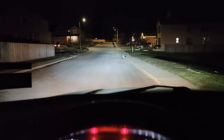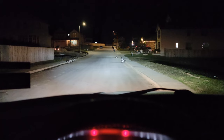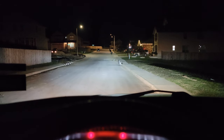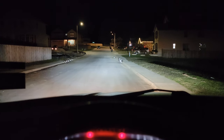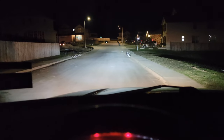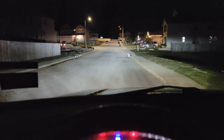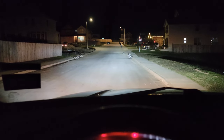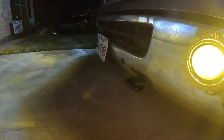I wanted to do a quick comparison as a follow-up to my previous LED headlight bulb swap video. After finding the manual and rotating the bulbs to a more vertical orientation — with LEDs on the sides instead of top and bottom — it significantly improved the light output. The pattern is now very smooth with no blotches. The big change is that the high beams actually are bright now — before they looked almost the same as low beams, but now high beams actually have additional reach and function like high beams.